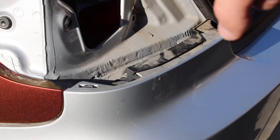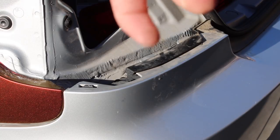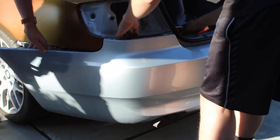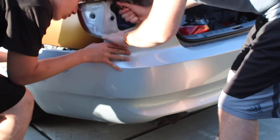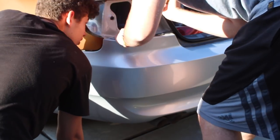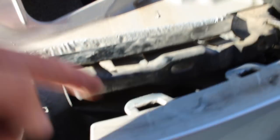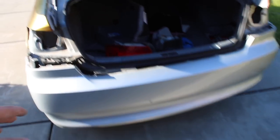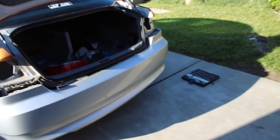At this point there are clips sitting right above — see that black panel? There's a piece sitting in between the bumper. What you're gonna do is pull the tab up from behind the bumper and then pull them up and around. Have one person pulling up on the tabs and the other person pulling the bumper. You've got to push down on the tabs — it allows these to come up and out so you can pull it. Once you do that it should just come right up. If you have sensors, make sure you bring it out a little bit, unplug the sensors, and then go forth with the rest of the installation.